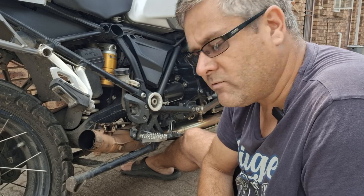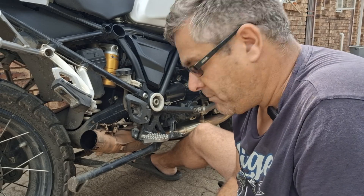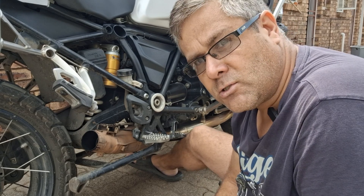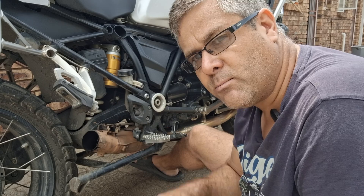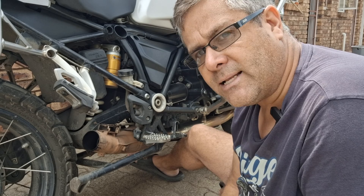The final thing I want to do is remove the catalytic converter. I can see there's the box for it. This is a stainless steel pipe. I've got stainless steel rods to re-weld it if I cut a hole in it. Usually they say you have to cut the hole from the top and after removing the catalytic, you can put the plate back and re-weld it so you can't see where you've done that.